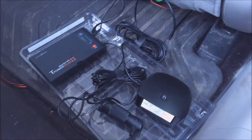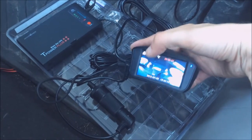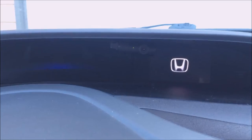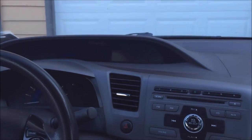Under my passenger side seat I have a T-Power Plus Alpha, and that powers the Street Guardian ZC12RC. It's a remote lens camera — all these cords are wrapped up — and this allows it to record inside my car while I'm driving and while I'm parked, so if something happens inside my car or someone breaks in, it's going to record. The lens of the camera is in my dashboard — I actually took my dashboard apart to install this remote lens camera facing me, the driver, so it records the entire inside of the car including outside the driver's side and passenger side windows.